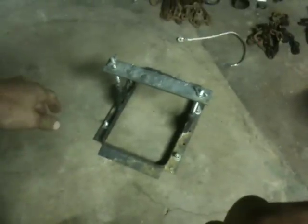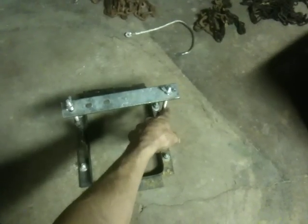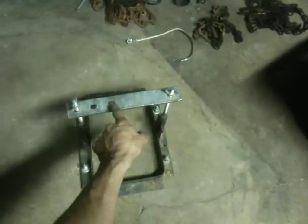Battery mount — this is another important thing. You're going to need some sort of battery box or mount. Milk crates do not work — do not use a milk crate because you will lose your battery. They do break. This one's made from an old bed frame, quickly fabbed up with a couple of long bolts and a shackle from a shackle kit, and it works really well.